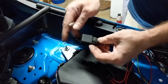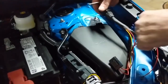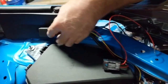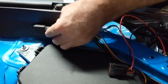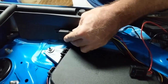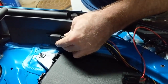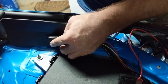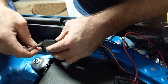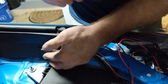This is our relay — it comes with the kit. We just ran the wire down behind the headlight underneath for the switch. We were looking for a place to mount this and we're going to mount it on this plastic cover here. Instead of using a screw, we're going to use a plastic pushpin so that if we need to remove it we can just take it out. We're going to drill a hole that matches the same size into here and use a plastic pushpin — it should look nice and finished.